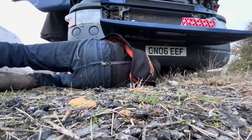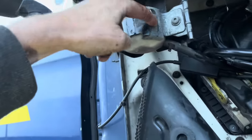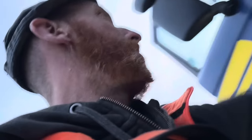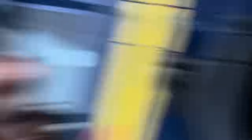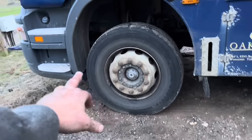That nut's fallen into the abyss — gone into the great abyss, so I've got to get another one. Just keep an eye on the reservoir level — I don't know whether you'll see it, but it's going to start rising as I'm bleeding from down there. I just don't want it to overspill and go everywhere. Dot 4 fluid — right, let me get my little homemade bleeding system on the job. Look at that — it's got all that thick grease on it. Look how high it goes with the air suspension lifted — handy going underneath, as long as it doesn't drop down on me.